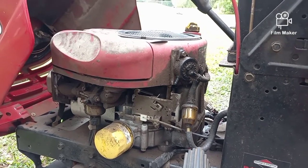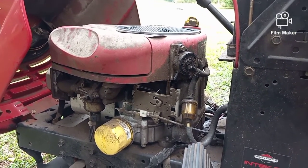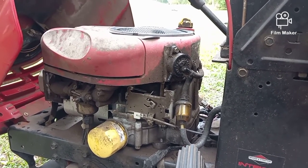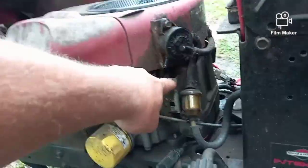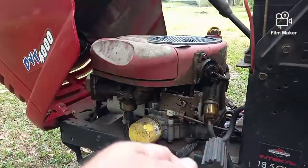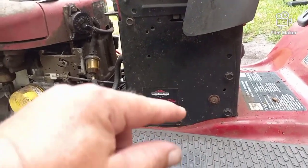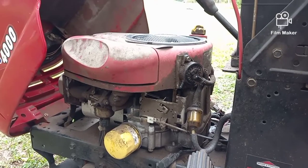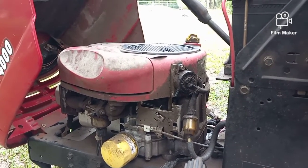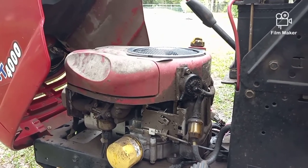Not a big deal. So we got to clean the carburetor and replace the fuel pump. The old hoses, the old lines, they're kind of hard and rotted, and one of them was bent under the frame over here, how it comes through the frame and goes underneath, and it had cracked. And that's more than likely what caused the fuel pump to go bad. It couldn't suck the fuel, it was trying to suck really hard, and it just blew the diaphragm.